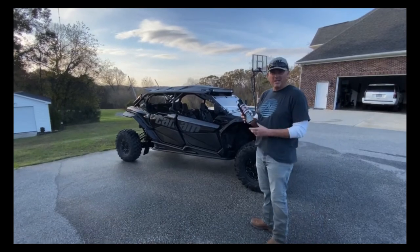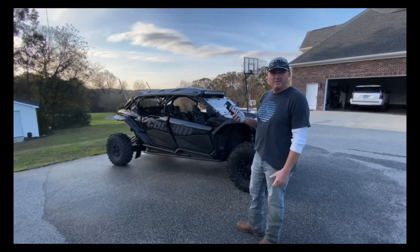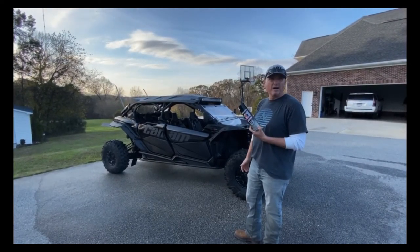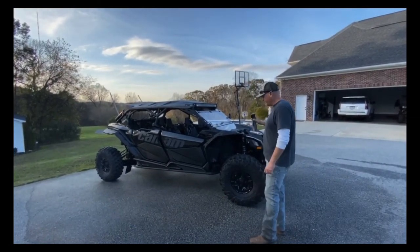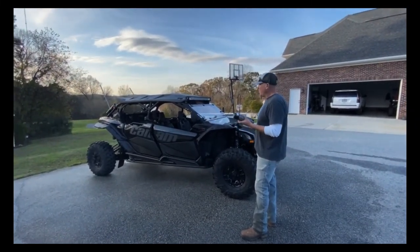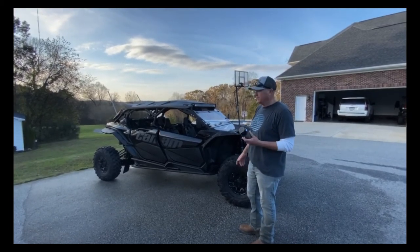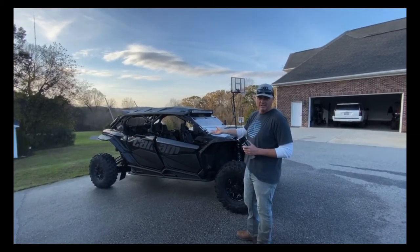What I do after that — this is kind of like magic in a can — it's called SC1 High Gloss Coating. You can get it at any motorcycle store, most dealerships, or Cycle Gear. I'll put a link in the description — you can get it on Amazon or eBay too. But this stuff is fantastic. You just spray it all over it: underneath, all over the top, sides. It's a plastic kind of seal coating. Once I spray it all over, I'll come back and just lightly wipe it in — that'll help not attract so much dust, because this stuff will attract dust. Just try to keep it off your seats and your exhaust, because it smells pretty bad once it gets hot on the exhaust.